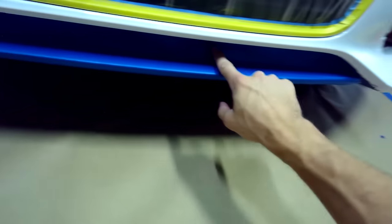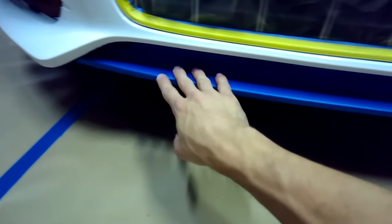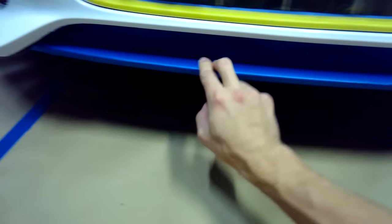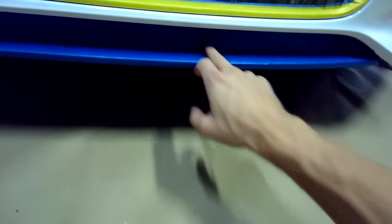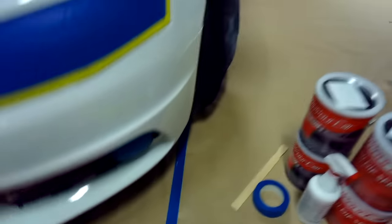Down here there's a lip area with a vent area right above it. We want to make sure no overspray goes through that vent and we want to keep the brushed aluminum lip for a little contrast off the trim. So we covered all of this section with layers on layers of blue masking tape, making sure each layer overlaps the other so that even if the tape pops up a little bit, none of the overspray goes through. Always remember to mask off the underside as well, because sometimes overspray can get underneath there.